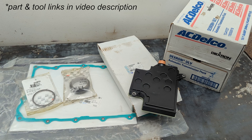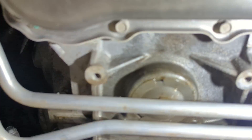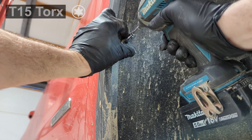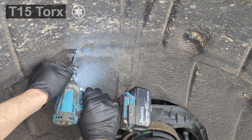I cleaned up the area with a little bit of water, dried it off, and readied myself with anticipated parts: a couple of gaskets for the exhaust, a filter, and a pan gasket. I'm going to start by lowering the exhaust, and to do that I'm gaining better access to the area by removing the inner fender liner on both sides.